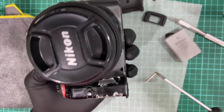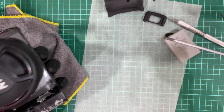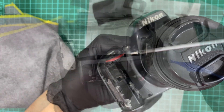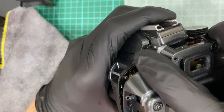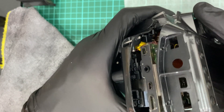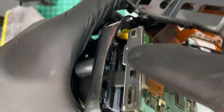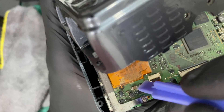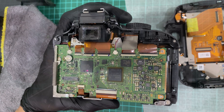This one is slightly longer and stainless steel silver color. The next one is short — the normal size. Now you just need to pry open the cover. I find it quite difficult to remove because the USB socket here prevents the cover from coming out. At the lower left-hand edge you need to pry open — be careful, there's a flexible cable there. Use a plastic spudger to remove the flexible cable.